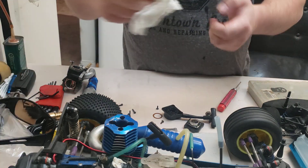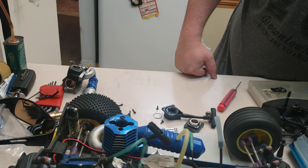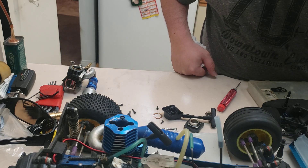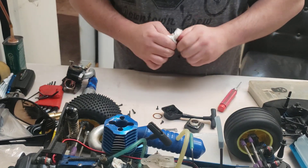I'm going to go over here and just take this one-way bearing. We're just going to clean it out with some brake parts cleaner - just let it hang and kind of soak and then we'll get it cleaned out. Because they do get oiled as soon as you start it again anyway, but just to kind of get any varnish out of it.